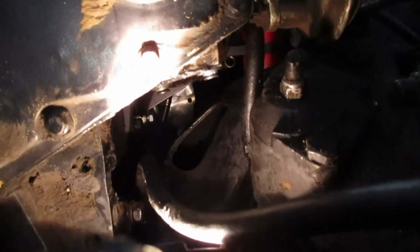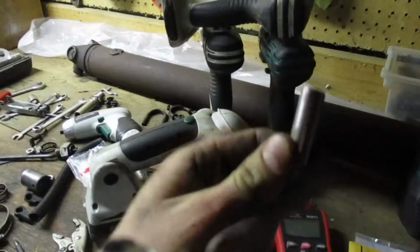And then we also got, let me go get my light here. Okay. We also got this plate on the bottom. I don't know if you can see that. Yeah, we got that plate on. Put some gasket maker around there. Hopefully that'll solve that whole problem there. I took the cylinder out, which is right here. That went up and down to pump that thing. So there shouldn't be any hitting against that plate. It should just have a little bit of oil contamination if it fills up there. It might not at all, but that's the best I could do, and hopefully it doesn't leak. If it does, we'll probably put more gasket maker on there, or we'll create a different custom plate.